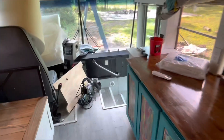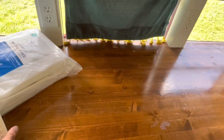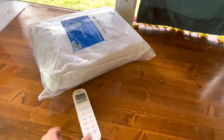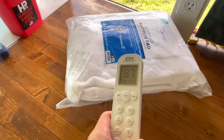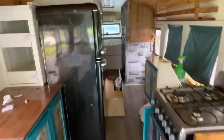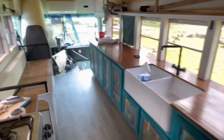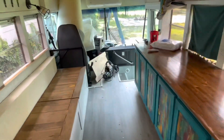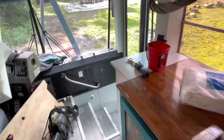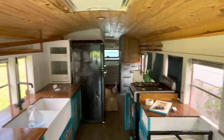Most of the factory windows are here at the front, but this front mini split is not working — I'm troubleshooting it. It lost its freon because of improper torque on the copper fittings. It's 87 degrees up here, so we're talking a 10-degree or more difference, and this is while parked in the shade. A fan back here pulling air forward would help, but there's no way you're cooling this bus in actual hot weather — and we're only at 82 degrees right now, not even that significant, and yet we're at 87 up front.